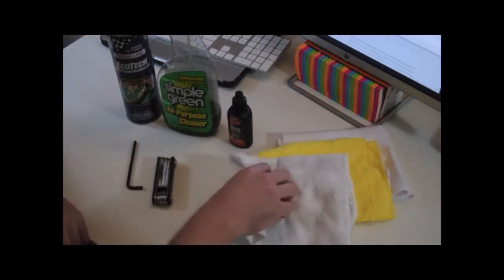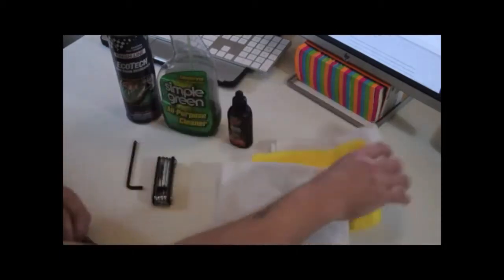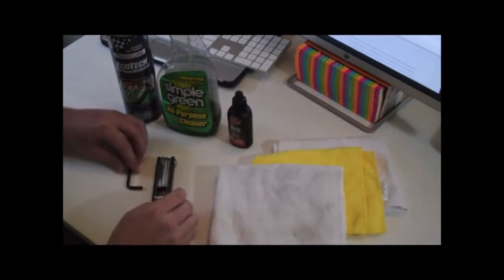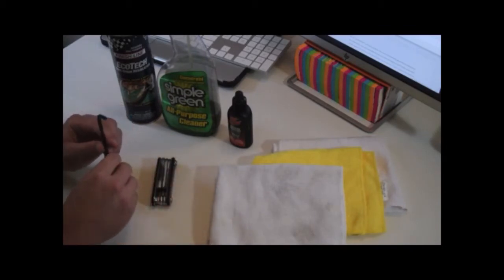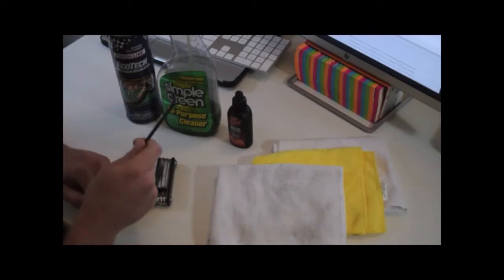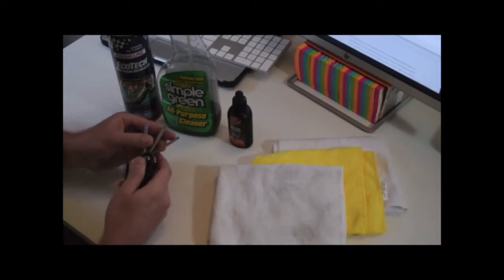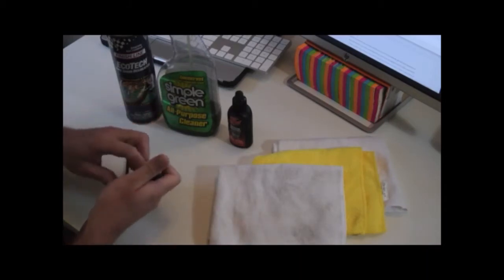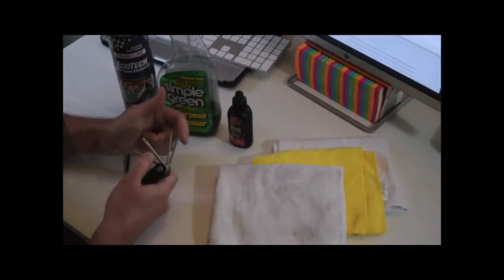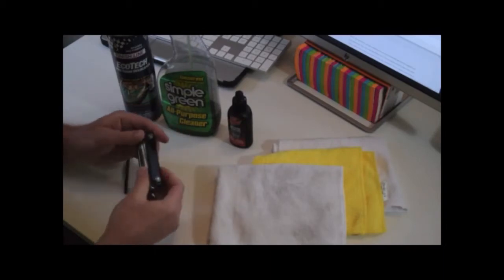To clean up the gears and chains we're going to need a few clean rags — clean rags work best so you don't get any gunk back on your chain while you're trying to clean it. And the last thing we'll need is some tools. If you have a bolt-on wheel, you're going to need a hex wrench to get it off. All bicycles use a metric system, so most likely you'll need a five millimeter hex wrench. I also like to have a multi-tool, which has various sizes of allen wrenches — six, five, and four millimeter, as well as two-and-a-half and three millimeter — plus a Phillips head and flat head screwdriver. It's really useful when you're on the road.